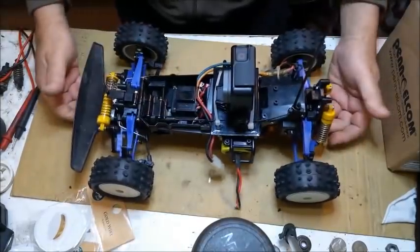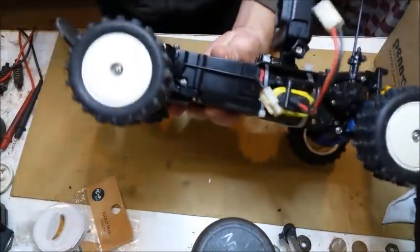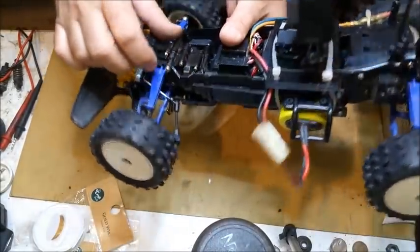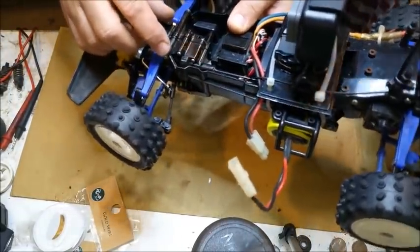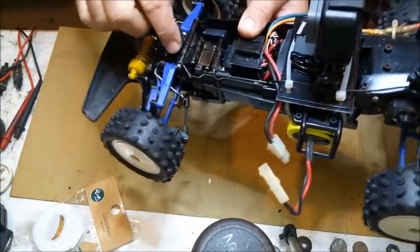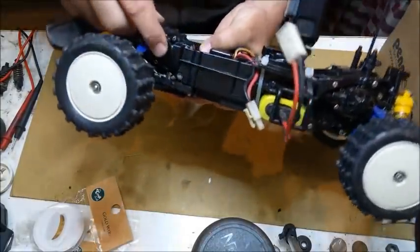The next thing, getting back onto this car, I didn't show you, or at least I couldn't show you too well, the repair. There's the repair there. And I've ramped that piece of steel. It's just, what is it, 0.8 sheet stock. I've ramped it up to the top there, where the fastener is. It was just sort of like this little plastic protrusion that supported it. It was no good. So that's all epoxied in and a bit of satin on it.